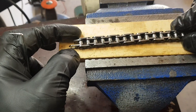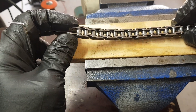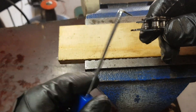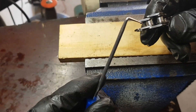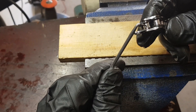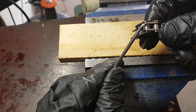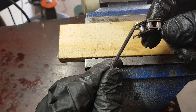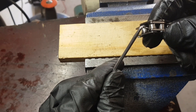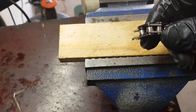Finally let's look at the oil pump chain. The rollers are scored. Clearly the chain was jumping heavily on the sprockets before it snapped, and those marks can be seen all over the chain. There is also a big play between the rollers and the pins of the oil pump chain — those parts were severely worn out.